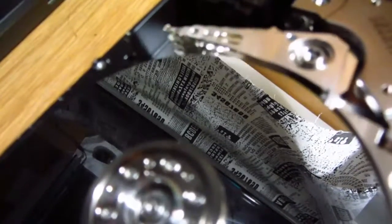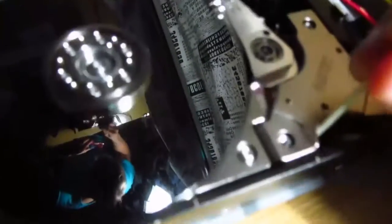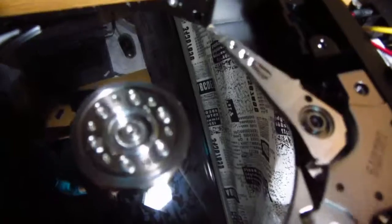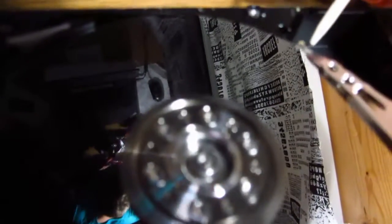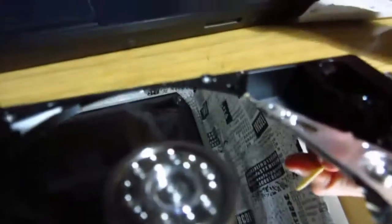My final diagnosis is that the heads are broken. Maybe the reading element is broken — I think so, because at first I thought the problem was with the positioning. That's why I cut it off. But when I hold it back with my stick so it cannot go and read anything, the hard drive just stops spinning. It seems it wants to read something and cannot, so it tries to reposition and still can't read. Maybe if I had another head I could fix this, but there's also the scratch, so I think this one is dead.